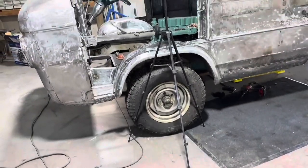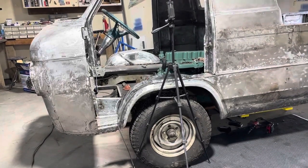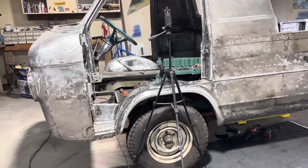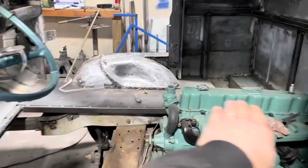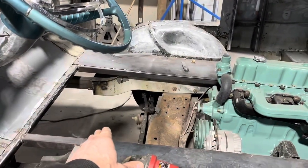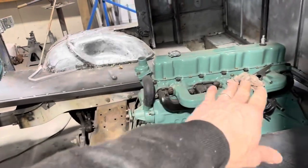I need to kind of start figuring out the shape of the doghouse a little bit, because I gotta figure out the upper mount. Well, the upper mount will be the top of the radiator. That will be the takeoff point where we angle down, because radiator's gonna come here, doghouse gonna come across here, and then it's gonna angle down that way. Air will come in here, up through the angle, across the radiator.